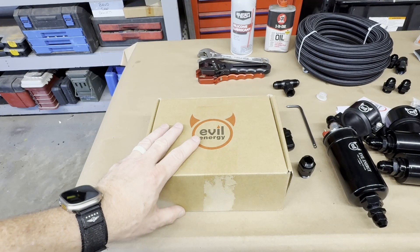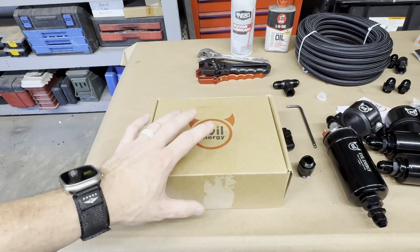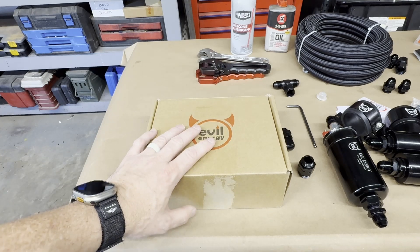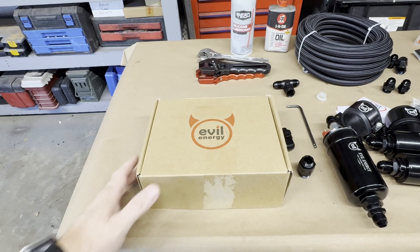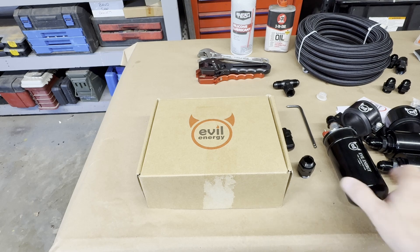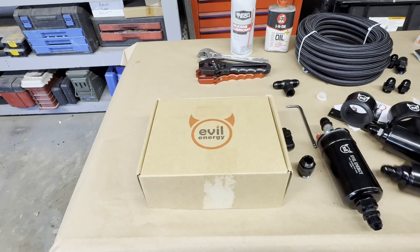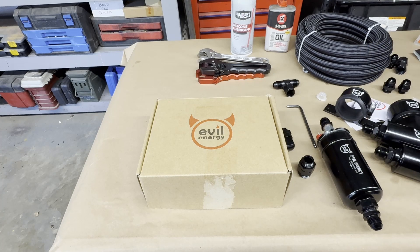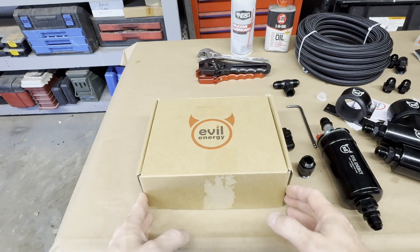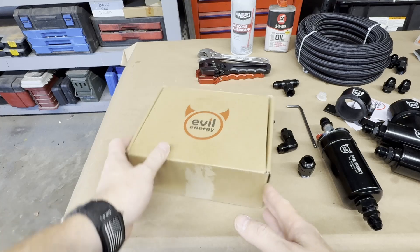Here it is. This is the fuel pressure regulator kit that came with my 15-gallon fuel cell kit that I showed in my previous video. If you didn't see it, I'll put a tag up on the screen or post a link in the description box. It was a 15-gallon fuel cell kit that came with a pump, two filters, the brackets that hold those filters, 20 feet of 6AN line, and an assortment of 6AN fittings — though actually that's my 8AN. I'm converting everything over to 8AN and I'll show you that in just a second.